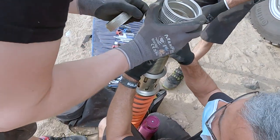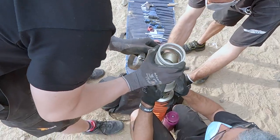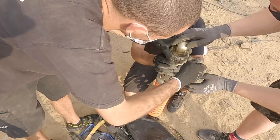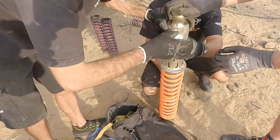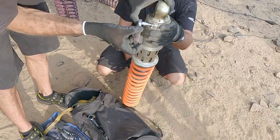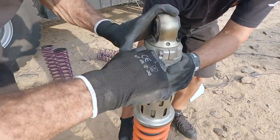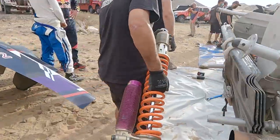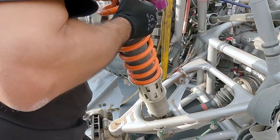And why did he swap this one? It's a different setting. We have three basically three main settings in the shock absorbers, and then you have small final adjustments. The spring stays the same on all the shocks in this case, but the setting inside is different. And we have different names for this — different setting names. This is Madrid, for example, probably what he was putting inside there. Then there's a Zaragoza one, and then there's a Dakar one.